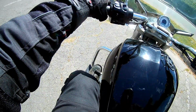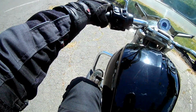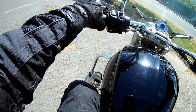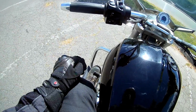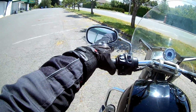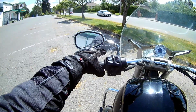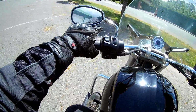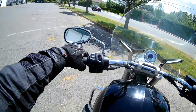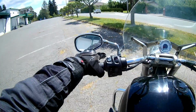And to make a good solid shift and never end up missing a gear and ending up in a false neutral and rounding out your gears and destroying your transmission, I also like to hold that pressure for a little bit after the shift until the clutch is all the way back out again. Once the clutch is all the way back out, the transmission is fully engaged and the gear is solidly picked and not ever going to slip back out and round your gears.